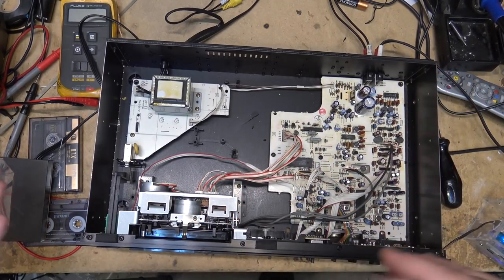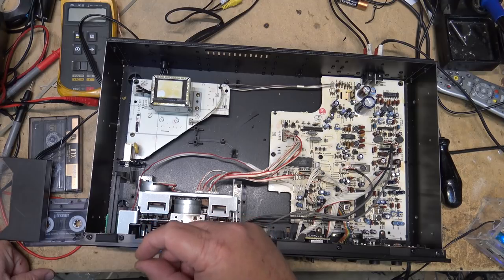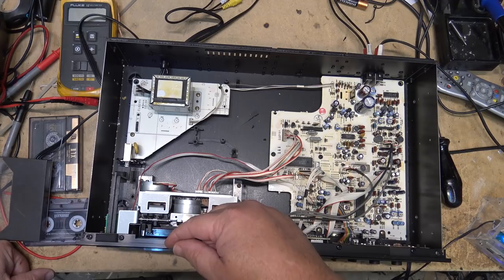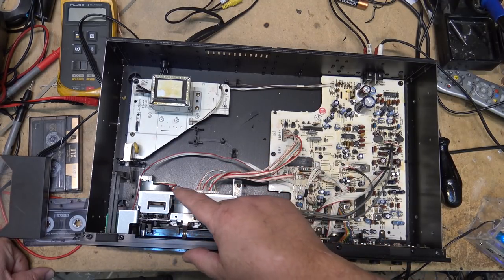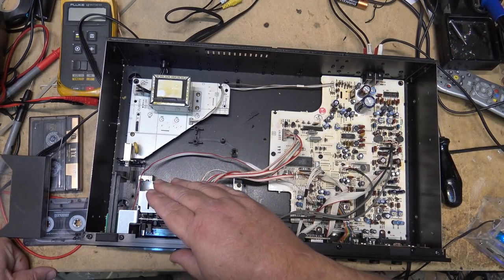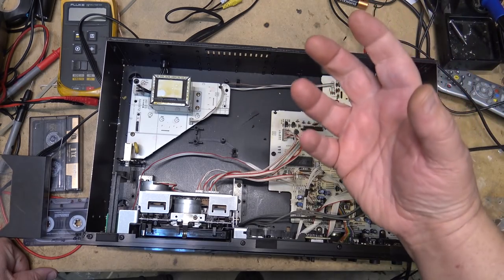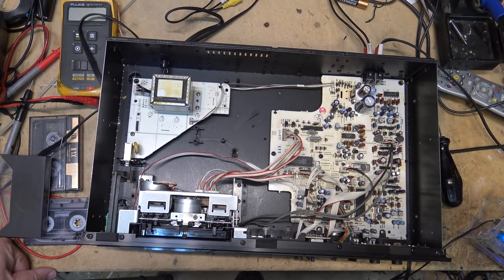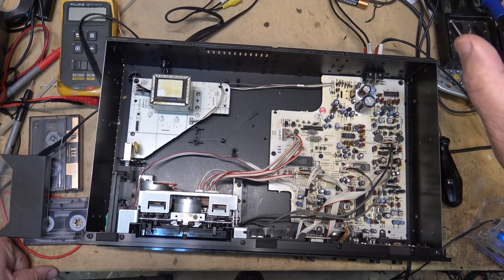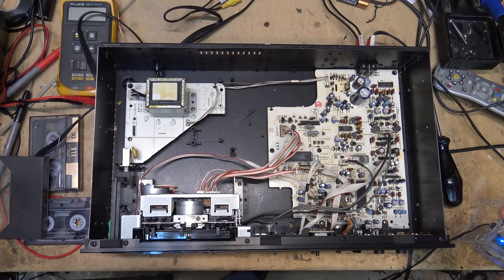It's all fixed — that's how you fix one of these motors that's seized up, as long as the contacts aren't burned up and it'll still turn. Sometimes the actual armature fails and the brushes go bad, and if that's the case you're foobarred. But if the motor's just seized up like that, you can generally take it apart, clean it, lubricate it, and put it back together and it'll be good as new. Yes, the motor is available, but by the time one gets ordered in it'll probably be $30, $40, $50, $60 — and any of these places like eBay want ridiculous shipping fees to ship to Canada. I ordered a transformer for an old radio and by the time it arrived it was $100. So if we can fix them without putting new parts in, that's all better. As you can hear, it's sounding perfect. Thanks for watching, we'll catch you again in the next one. Don't forget to hit that subscribe button to be notified of my new videos.